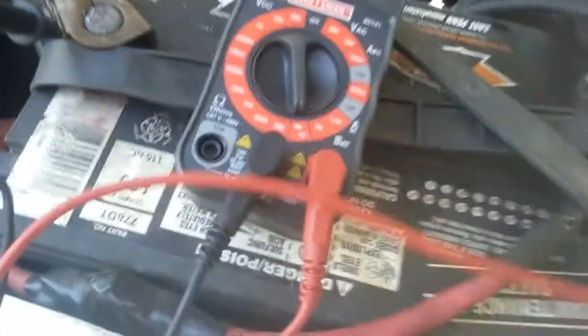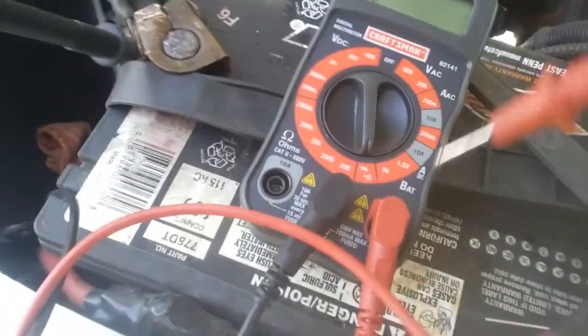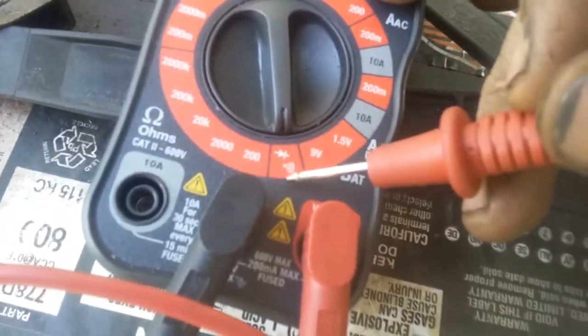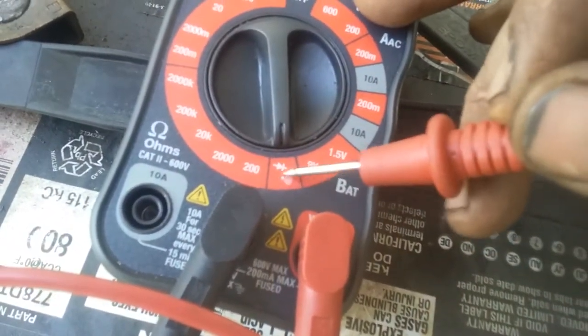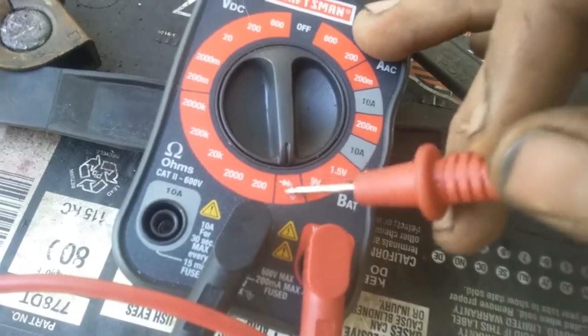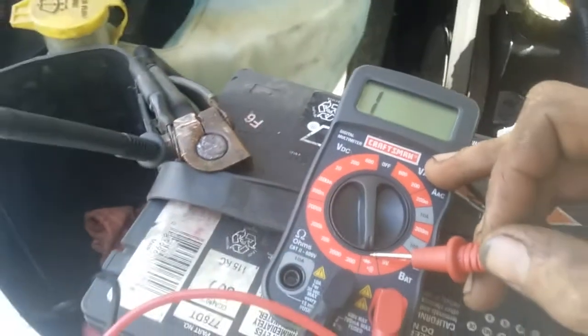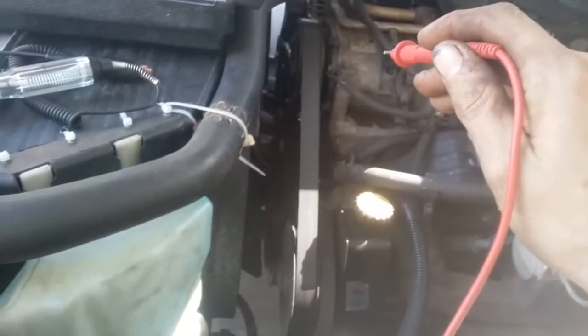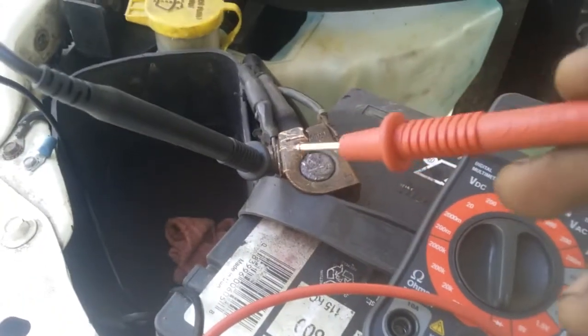However, I can do a lot of other things with it too. If I want to find a break in a wire, put one end on the other side, go to the continuity setting. We basically have this little speaker-looking symbol here, and that'll tell you if two things are actually connected with little resistance. For instance, if I want to find out if that engine's grounded or not, if I got some issue, I put one end of the lead on one end of the wire, I can take the other lead, and it should make a noise and tell me approximately how much resistance is in there.